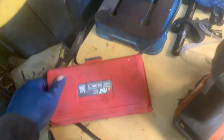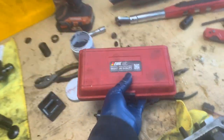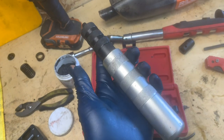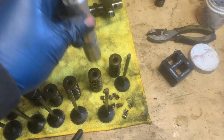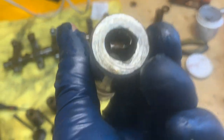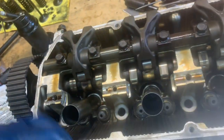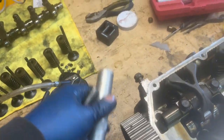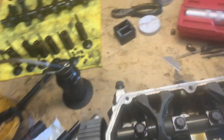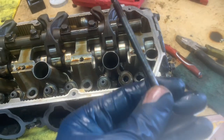I use this tool I got on Amazon — it's the EWK valve spring retainer remover. It's got two different things: this part lets you pop the valve spring keepers off by placing it on top of the valve spring and hitting it with a hammer, which presses it down and ejects the keepers into the tool. It's been very well used — done quite a few jobs with it. It also has an install tool where you press and push it in. I haven't got that install tool to work well for me, so I'm going to do it a little differently.